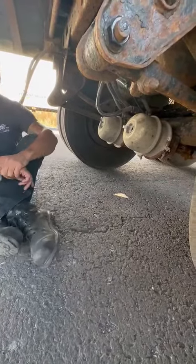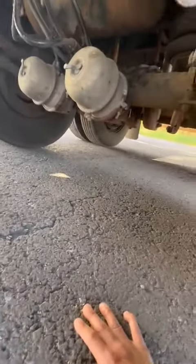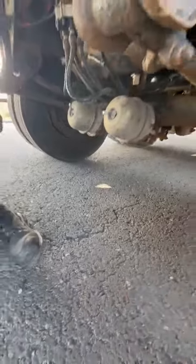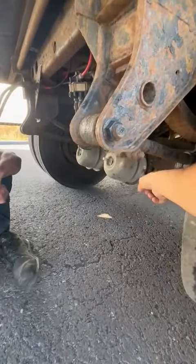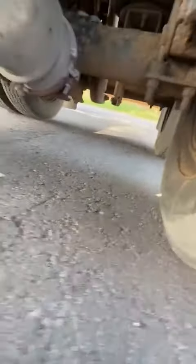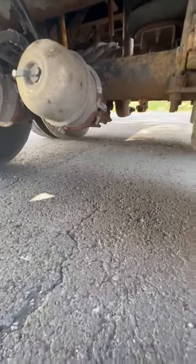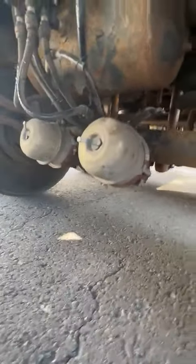Do my brakes look properly adjusted? This one here — they look okay. It's a little bit more up than an L, but it looks kind of like an L. Yeah, so it's good. It doesn't have to be a perfect L, because they're self-adjusting.